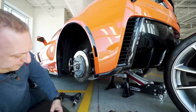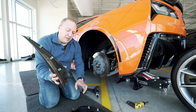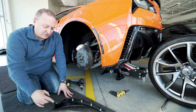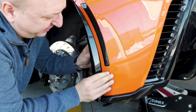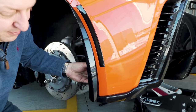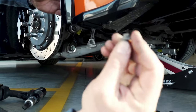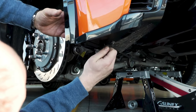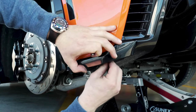The XL rock guard. I've transferred over the U-nut. We always have a U-nut at the bottom of the original trim piece, or your XL or the GM splash guard — this is transferred over to the new one. I line up my clip and apply pressure right over the point. I made sure the tab underneath slid under. And now we have our last seven millimeter screw, which is a common screw for both the rock guard and our fascia extension. I'm reinstalling my fresh rivets.